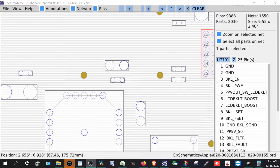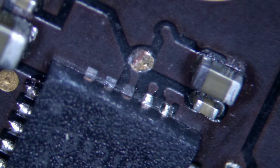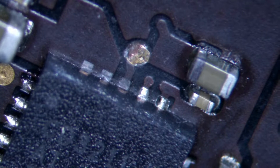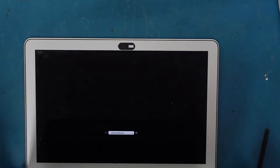Let's go ahead with the ultrasonic — I think that'll be the best thing. And going back to look at it, it looks to be pretty good even though it's not as shiny; the pads don't look completely damaged. The ultrasonic is going to take care of it. And there — green light, fan spin. It's going to come up. A little boot menu. Should be working. Processes are getting warm. Yeah, that was pretty quick! That means the keyboard is working too. Hold Option — everything looks to be pretty good.